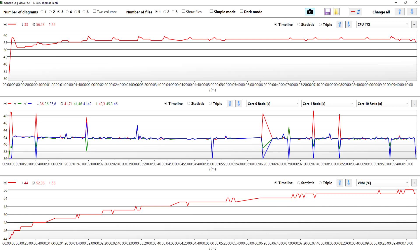For CPU ratios I recorded graphs using Hardware Info, which only allows three cores on one graph at a time, giving a spread of how the cores performed. My best core (Core Zero) hit a maximum of 4.93 GHz and sustained 4.17 GHz throughout the test. Most cores hovered around 4.2 GHz average. Core 1 and Core 10 hit maximums of 4.5 and 4.6 GHz and averaged 4.1 to 4.2 GHz throughout the test.